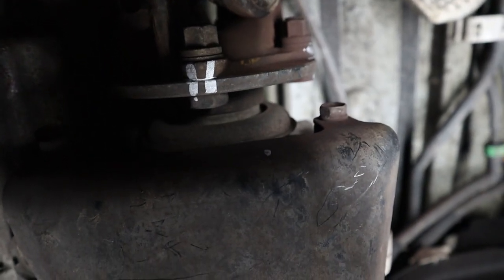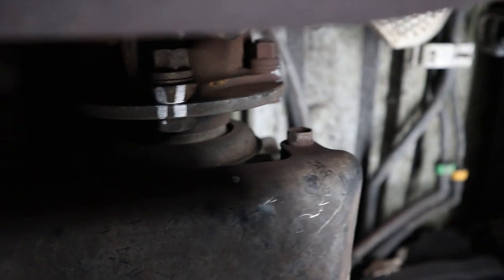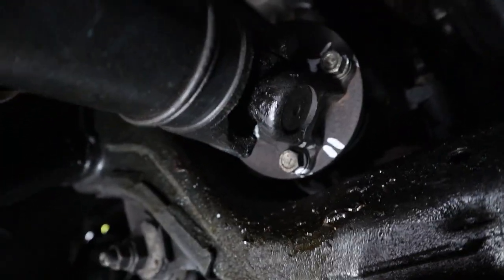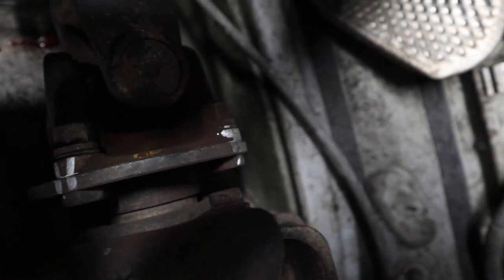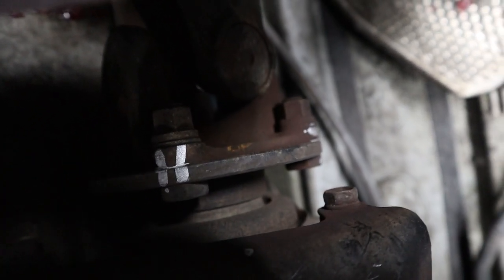This phase-marking tip is from Dan Coons — I probably would have taken this apart without thinking about it. You put markers for zero, one, two, and three — zero being no paint mark at all. Do the same on the rear side and mark the new drive shaft the same way. Just throw these marks on before you start unbolting and it'll make your life a lot easier.